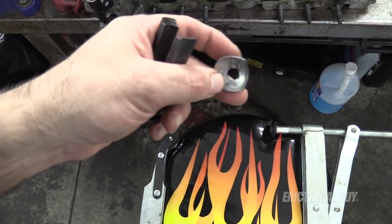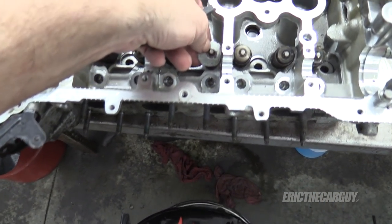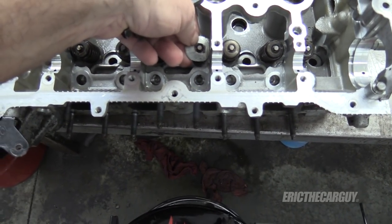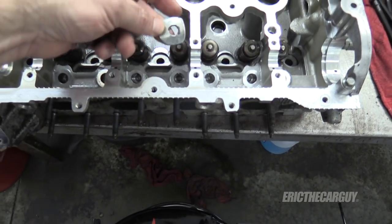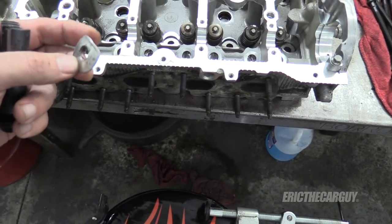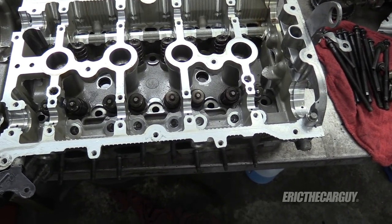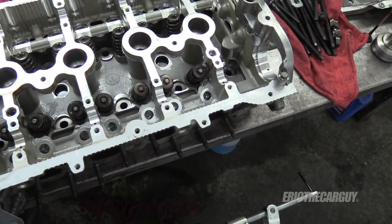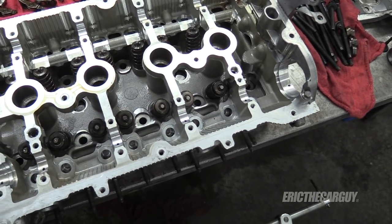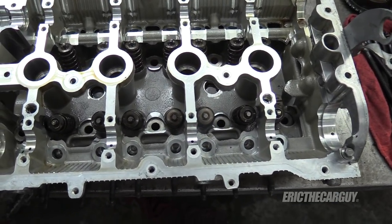So I took a washer, I drilled the hole out large enough to just fit over the top of the retainer, but I also had to shave that one side off to fit into here. Now it did get bent up during the process, but it did work also. Totally cheesy, but it did work. I would wager that Mini has a special tool just for this somewhere, somehow, but I'm not aware of it. But if I do become aware of it, I will post the link in the description for you.